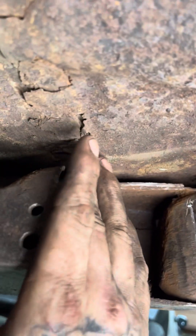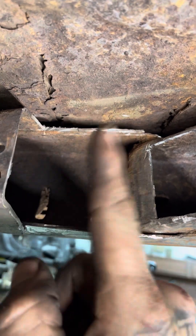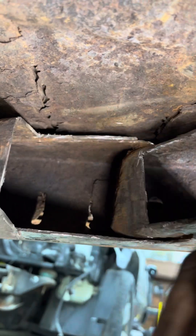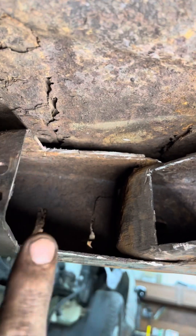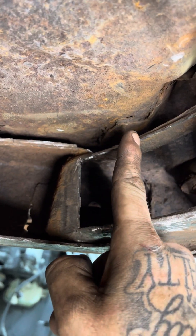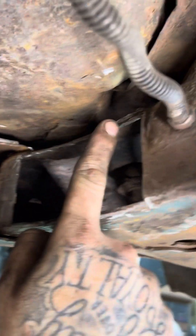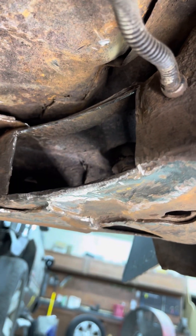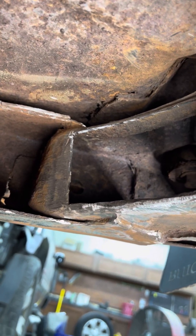You can see the floorboard needs some repair too, but he's just trying to get this car done a step at a time. I'll do that just to try to prolong it and keep it as weather tight as possible. Once I get that piece in there, then I can make my piece here and the piece that goes along the bottom. I might make this in one section, just bend it in the brake, bring the 90 on there, and it's going to come in and swoop and get tied into right about here in this patch. I'll go ahead and make that little bend in there, bring it up, then fill that gap in at the bottom and weld it all solid all the way around.